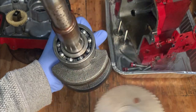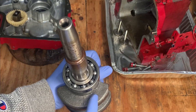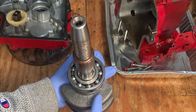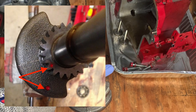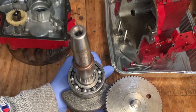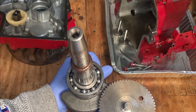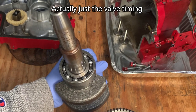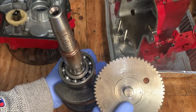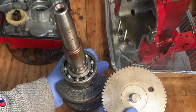The mark here on the counterweight is actually offset by a tooth. I saw some pictures of it online where they had this ball bearing removed, and it's very obvious it's a tooth different. So by doing it wrong by a tooth, you're affecting when the valves open and close and also when the spark happens. So although this top end has issues, this was definitely robbing power as well, if the spark and the valves were slightly off.